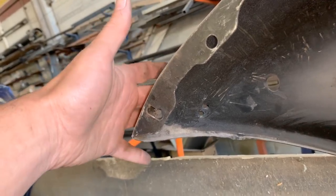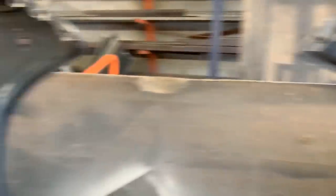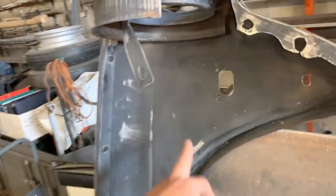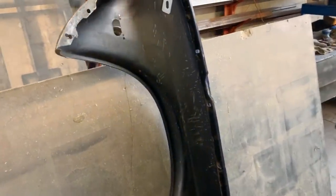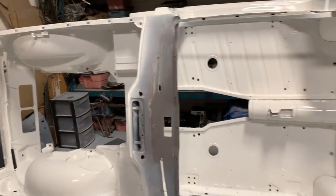So they are in good shape, but they still need some repair. For example, there are two holes here — I guess that's for the front spoiler — and here you can see this is bent. This one had lots of undercoating on it, so yesterday I literally scraped it off and then sanded the inside so it can be sprayed. I only need to wipe it with alcohol before we spray it. This channel here I sanded so we can paint it. We need to paint the inside of the fenders before we attach them to the car, so that's what I'm doing today — dealing with the inside of the fenders and seam sealing.